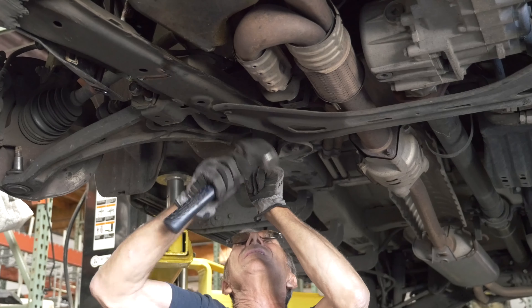Make sure that's nice and tight. A lot of times it's not as simple as you think until you start working on it — this is the technique you use. You're working on these three bolts: getting this out, getting this down, and then putting it back in. You've got to get that level. These you can tighten as much as you can because they're big bolts — they won't twist off. Then you put your other ball joint nut on there, and that's all you do to get the control arm done.